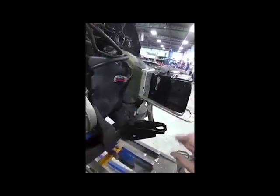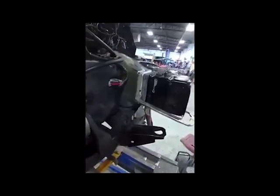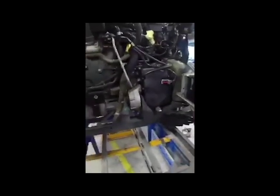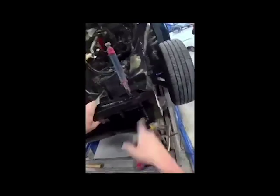So I'm going to go ahead and put some tack welds around this just to make sure it stays exactly where I have it. I don't want to weld it solid yet. Then I'm going to start fitting this plate on there and the rebar and everything. And then I will do the radiator support section. Looks like this bar and the plate all fit on there nicely, and it all measures out perfect, so I'm going to weld this solid, and then I will attach the plate that goes on the end.